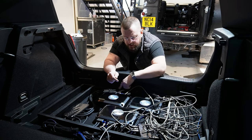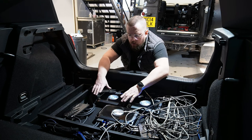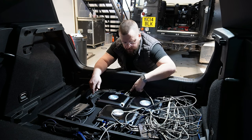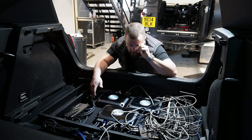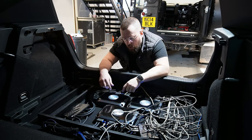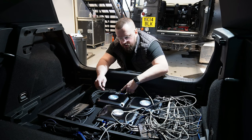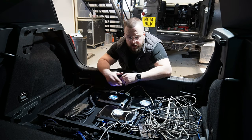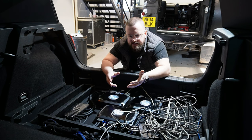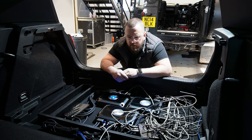There's a reason why these plugs are all outboard. If they weren't outboard, they'd be inboard, which removes space inside the amplifier — valuable real estate. So whilst they claim these are tiny amps, you're going to have to factor in needing at least three inches from the front if you're using decent power cable to install in a tight space. That said, having plugs outboard means more real estate inside the amp for amp components rather than cable inputs. It also makes connections a lot more substantial — we're not solid-soldered onto the PCB and then crimping down, so that is a bonus. I can put an amp rack together like this in around four hours using a five-channel, a four-channel, and an external DSP with RCA. This has taken me about eight hours.